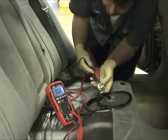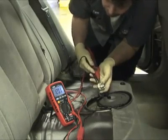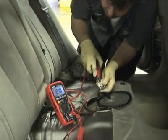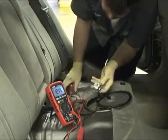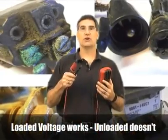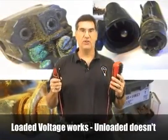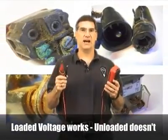You're getting battery voltage during crank and that makes sense because you're loading the battery. This is one of those times where you would start out with a loaded test. The wiring's good — that's how fast it is. We want you to start thinking in terms of reading loaded voltage. That's the only change. Add the word loaded in front of the word voltage any time you say the word voltage and you'll be getting an honest answer.